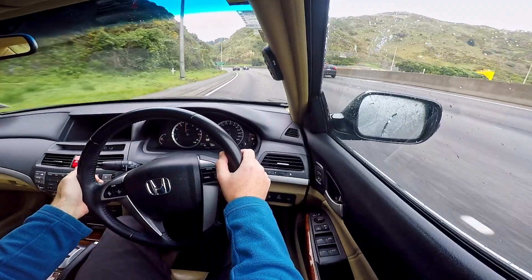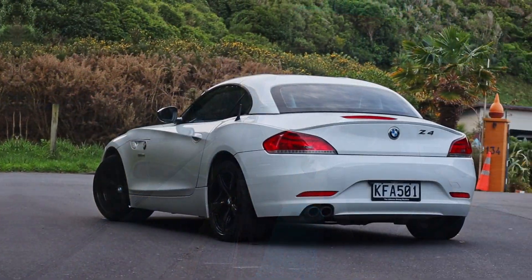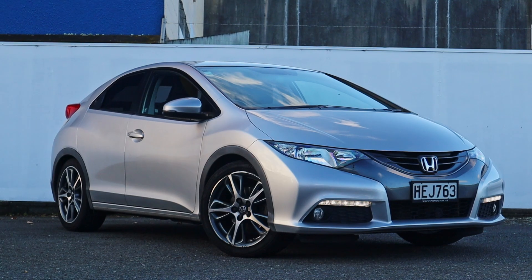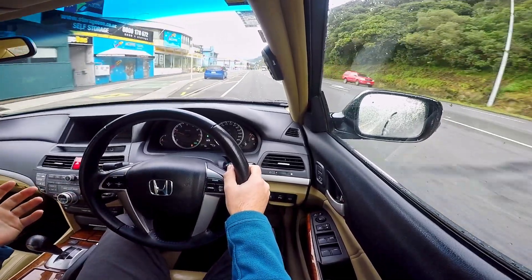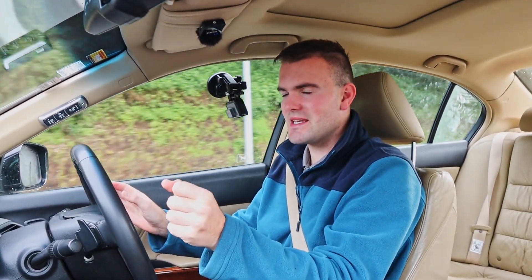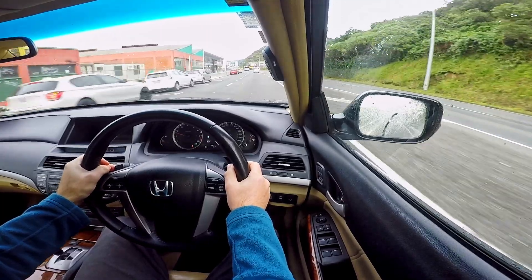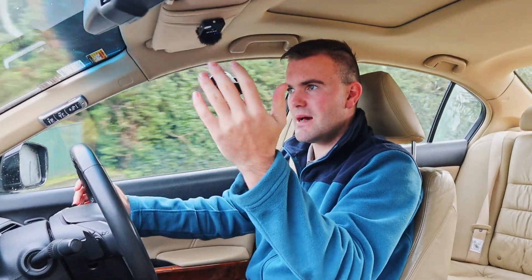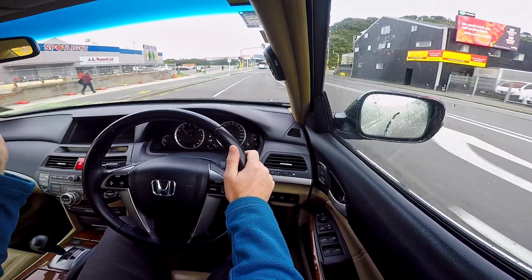...does not rev match automatically. How do I know that? Well, if I pull the paddle to go from third gear to second gear, you feel the car kind of lurches forward a little bit and there's not an obvious smooth transition. Really the only Honda that actually properly rev matches — like my Z4 — is the new Civic facelifts in New Zealand. No other Hondas rev match at all, or if they do it's only kind of like this Accord. Essentially, to rev match a downshift, all you're going to do is pull the paddle and then you have a brief window between when it's switching from one set of clutches for one gear to the other set of clutches for the other gear. In that brief window you can pretty much do whatever you want on the throttle — the car is for all intents and purposes in neutral. So if I'm in fourth, I pull the down paddle and then about half a second later just give it a stab of full throttle, I can get it to drop into third quite quickly, or second gear likewise — and it makes quite a good noise.